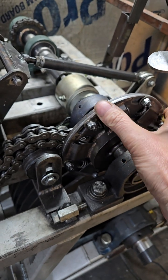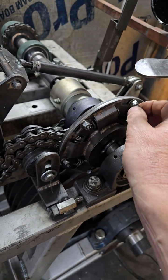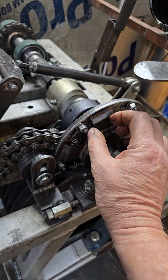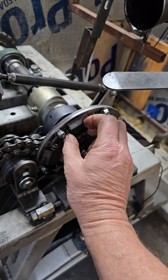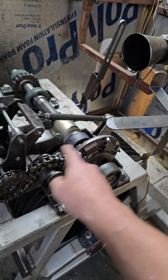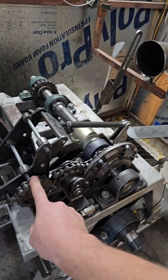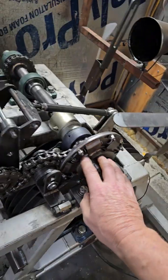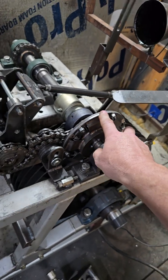So when the motor starts to run, and I've run a high-speed camera on this before, when you're actually starting into a pass, it starts to compress the springs down a little bit. If the motor starts to lunge on it, the springs will take up that shock and not put it all the way through from the sprocket, the output shaft, into this assembly. So this basically is the shock absorber, and that cured that problem.